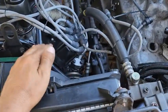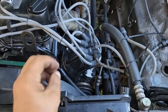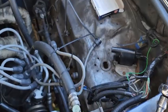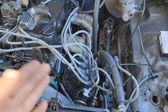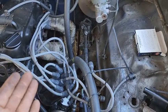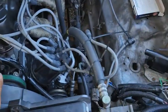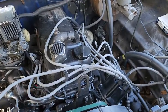Because I had that power steering leak — before I had it fixed — that connection and harness was completely covered and caked in power steering fluid, dirt, and grime. It short-circuited and fried the control module. Since then, it's been several months and I've only been running on the intake side without any issues. Obviously since the exhaust side isn't running at idle, those excessive exhaust gases aren't being burned off, so you can smell it at the tailpipe. That's part of the reason I installed these iridium spark plugs — to increase the spark and get a better burn.